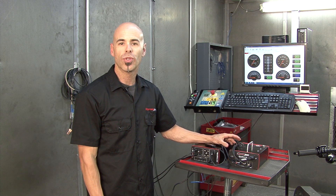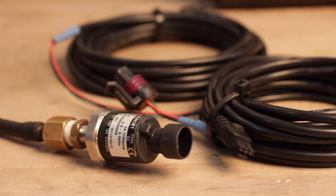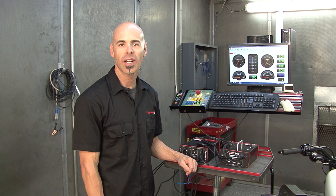The four analog inputs are a true 0-5 volt signal. These can be used to tie into a sensor on the bike that's 0-5 volt, such as temperature, pressure, or even to read fly-by-wire. With fly-by-wire you'll be able to read throttle grip position and tune the bike more efficiently. You can also use one of DynoJet's pre-configured sensor kits. The four CAN inputs on the DynoWare RT module allow you to connect to DynoJet products such as the Power Commander or Wideband 2.